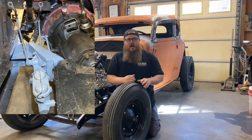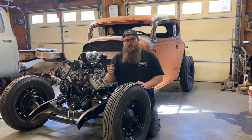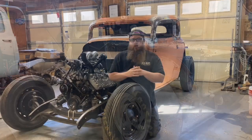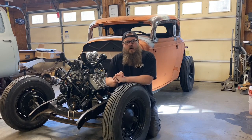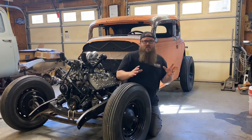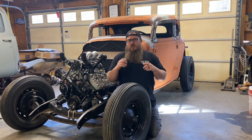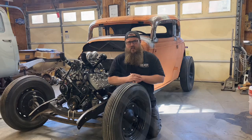I have it in the 34, I have it in my 31 Roadster, and I also have that exact same pedal — even though I have an automatic transmission — in my 28 Roadster pickup truck. It's a very versatile pedal; you can get split master cylinders for it, you can run a hydraulic clutch, or a mechanical clutch with those pedals. I love looking inside a traditional hot rod at the floor and seeing the pedals come up from the floor and not down from the firewall. It really gives you that traditional look with those little biscuit pads, and this looks really, really nice.